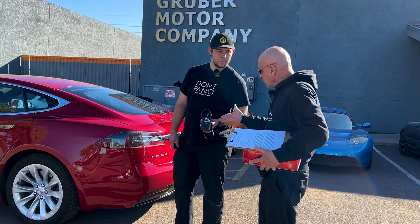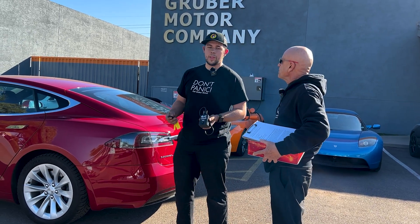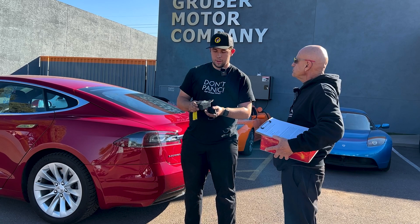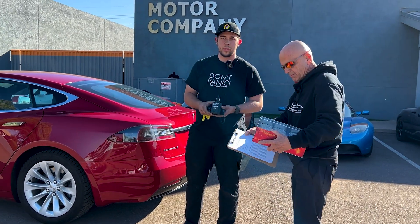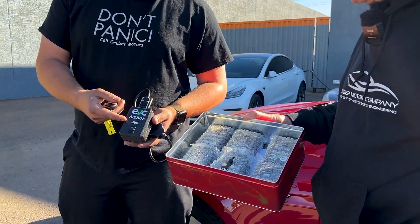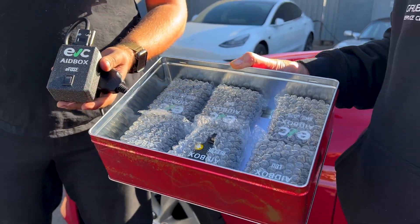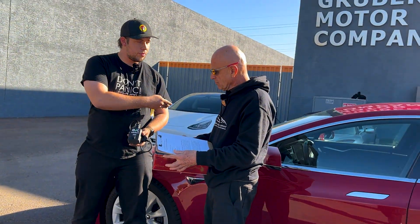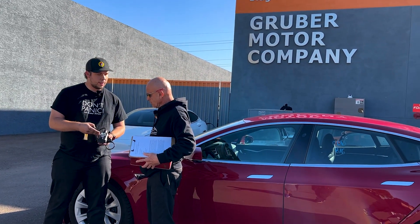Kyle, what will this box do with this car? Tell us about the problem. So the Aid Box system is a variety of these, and it solves a lot of the common problems with your Tesla Model S and X vehicles. This right here is the eFuse, which is located in the battery pack. We've already replaced the eFuse in this car, but it's still throwing the code for it. So we're going to plug it into the car and make sure this code never comes back.